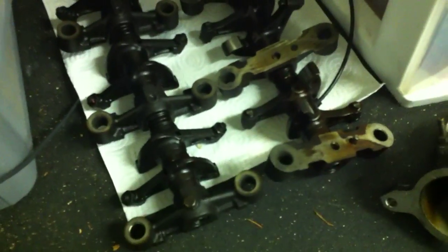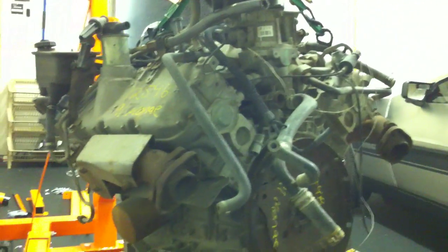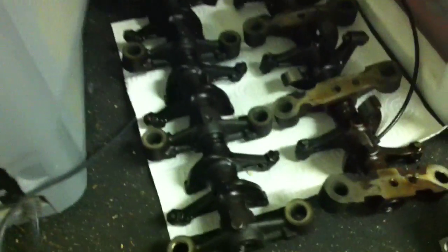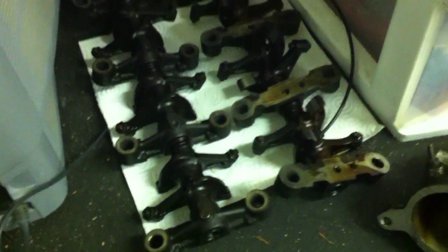Another upgrade you can pull from the B280 engine is the rockers. These are mechanical, not hydraulic like the ones in the Eagle engine. As I've been told, mechanical rockers are better for higher RPM — the hydraulic lifters in this engine aren't as responsive for moving the valves. These don't have rollers; they're just smooth pads. Newer engines use rollers, but apparently this works just fine.